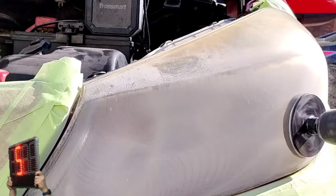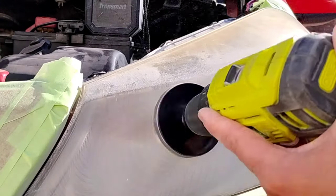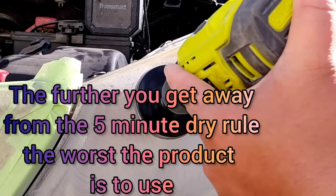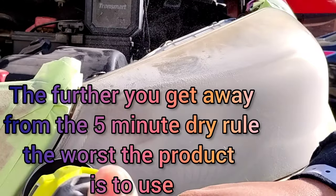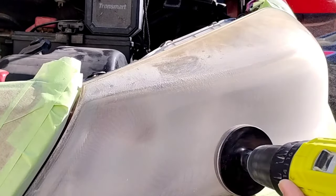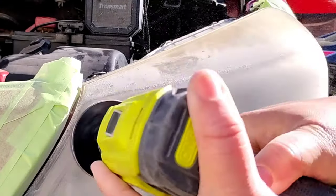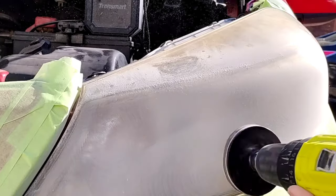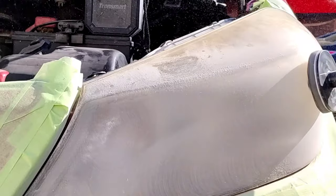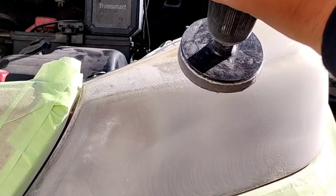Headlights need to be sealed fast, and they need to dry fast. It doesn't need to cure all the way, but that surface needs to crust — which just means the surface of the headlight drying first. It's going to dry from the outside in because it's exposed to air and environmental factors, which are going to dry that crust faster.